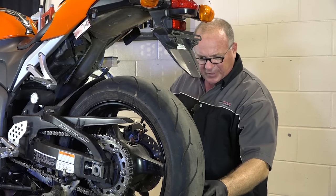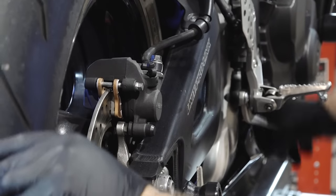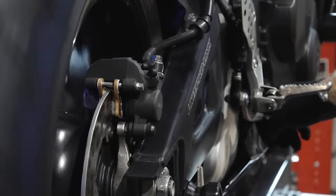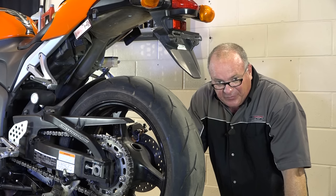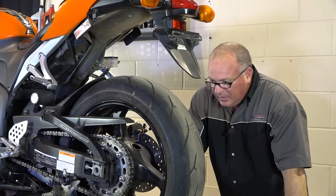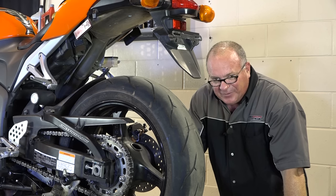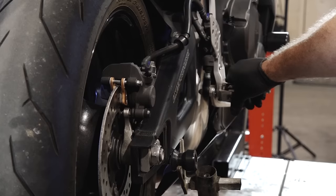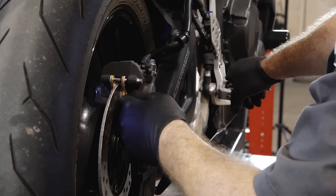Little trick so you don't get any big surprises when you crank up the machine and go for a ride — let's go ahead and pump it up, make sure she's going to grab. Alright guys, really that's about it. Really simple procedure, you can do it yourself. Save yourself from having to go to the dealership. If you're riding along and you've been doing your pre-ride inspections like you're supposed to and you hear a bunch of grinding going on in the back when you hit your brakes, you probably need to replace your pads. One of your pre-ride inspections, you want to make sure you've got at least an eighth of an inch left of pad material on the pads.